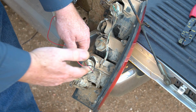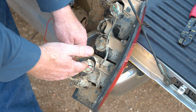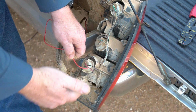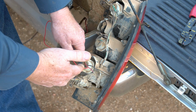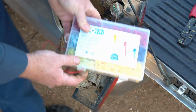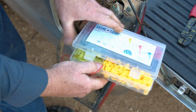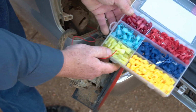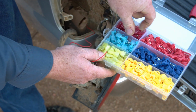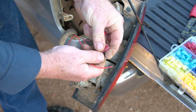It is only necessary to use it as a backup camera if you want the display screen to automatically switch to the rear camera whenever you put it in reverse. So that's the purpose of this wire. I'm going to use one of these little connectors to connect to this wire, so I don't have to cut it or solder it. We'll go ahead with the red one here. We'll take two parts. Okay, this is going to attach to here.